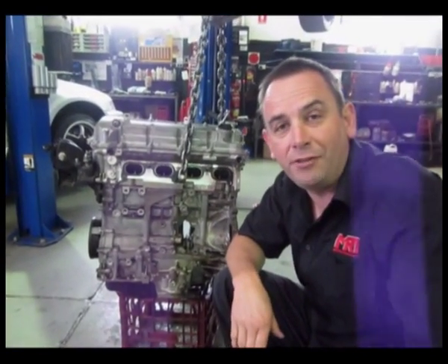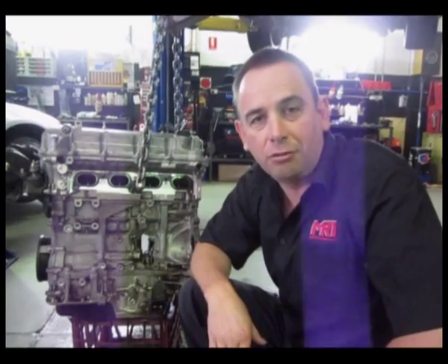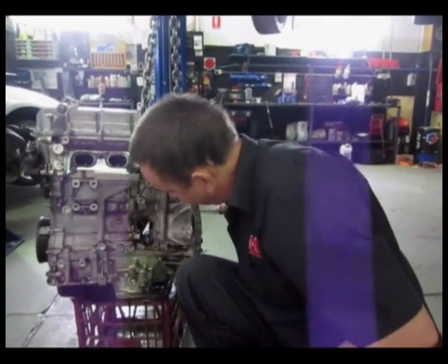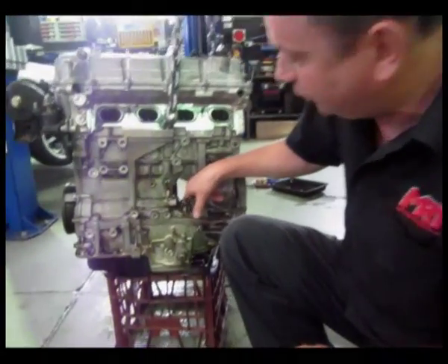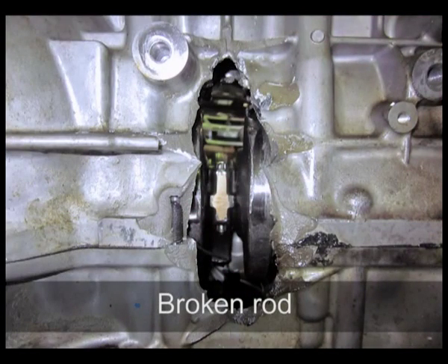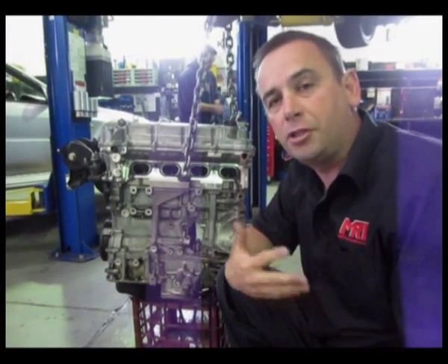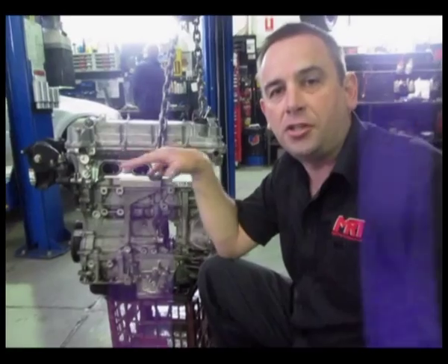This is the result of some pretty heavy duty durability testing. The Evo 10 engine in the MRT car has had a lot of testing over the last year or two, and our aim is always to find the limits — and sooner or later we knew we'd find them. You can actually see right through the block; the conrod bearing is still turning quite easily on the bottom of the crankshaft, but the rod has actually broken in the middle. One of the traps of this engine is that over a period of time, it will bend a rod due to excessive boost or a bit of an over-rev — it is a well-known fact these engines will fail through a bending of the conrod at a certain boost level.